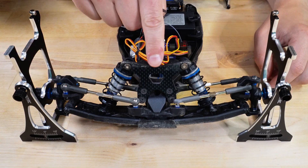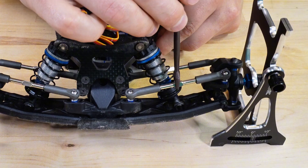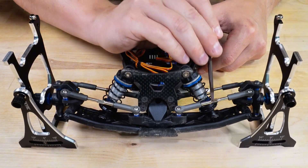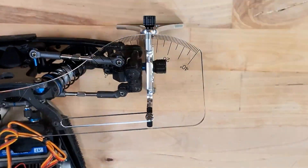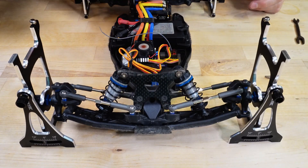Then I made another iteration on adjusting the camber. The angles became a little off after I adjusted the toe, so I had to readjust them. After setting both sides to one degree, it was time for another check of the toe angles. Some small adjustments were needed there as well, complicated by the wiggle again. The last check of the camber showed that it is all good this time, which means I am done. Hooray!